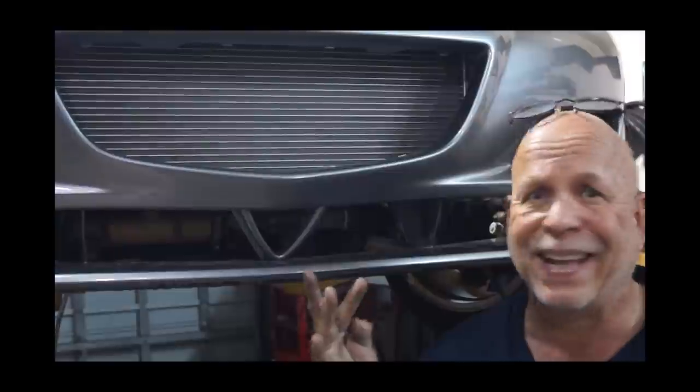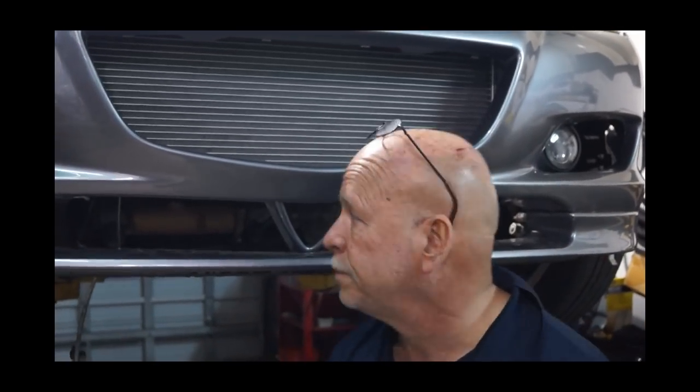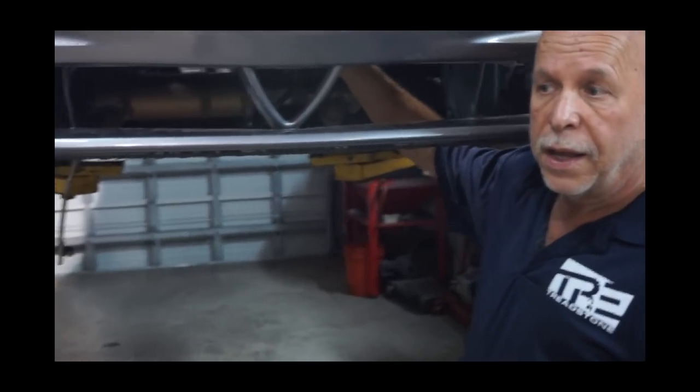When you have all this stuff in front of the radiator, that's when you get issues keeping the engine cool, because the radiator loses efficiency with air going through the intercooler and gets hit with heated air when the AC condenser is generating heat. That's not going to happen here. The condenser core is going to go in front of the intercooler but at a good distance, so it will have plenty of opportunity to dissipate its heat. Everything is going to work more efficiently — everything gets a direct straight shot of fresh air. Nothing blocking nothing. We've got the space, might as well take advantage of it.